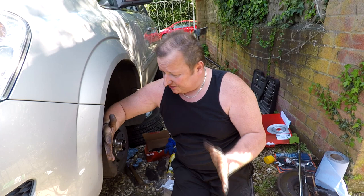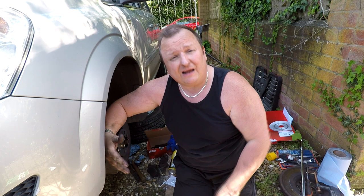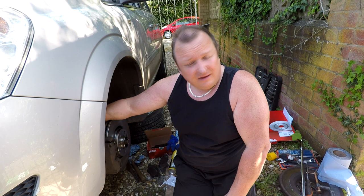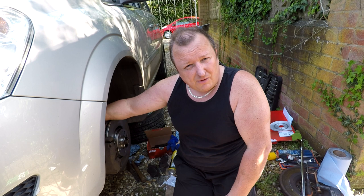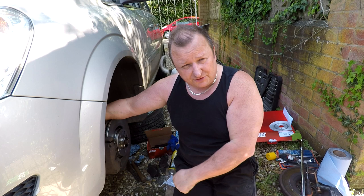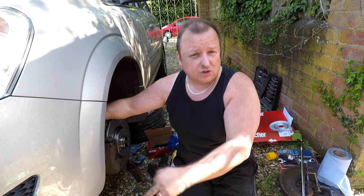I'll leave it there with this one - been a right pain with Euro Car Parts but we got there in the end. If you've had any problems, leave some comments below and let's hope their customer service gets a lot better. One thing to note though: if you've got a Vauxhall Zafira B like this - this is an 08 model - they do two sizes of discs, a 280mm and a 308mm. So do make sure that you get the right disc when you go. It's on the website now apparently, but the second size had scrolled right to the bottom, which is why Gary missed it. So if you order them online that is a problem. Thanks very much, I hope you've enjoyed this video - share it and we'll see you next time. Bye for now.